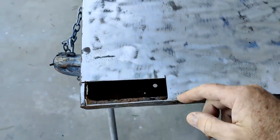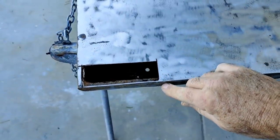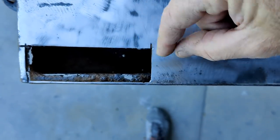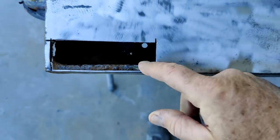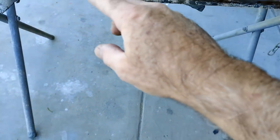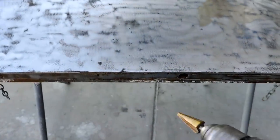But what I think I'm going to do is cut out a little bit further and then just cut through one layer here, because I need a little bit better metal. It's better about right here, where I'm at, but I just need to go a little further out and make the inner panel first, then I'll make an outer piece. And then there's a couple of pinholes along here, so let's take a drill and open them up and look at them. All right, so good.